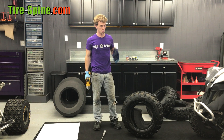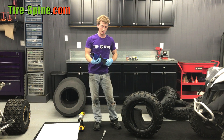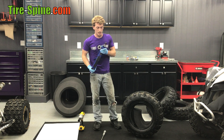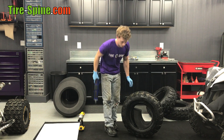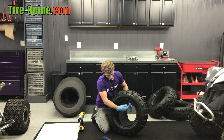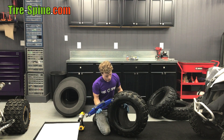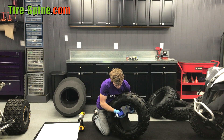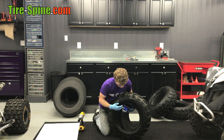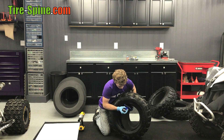Unlike the Sport ATV, you will need a couple other tools. These are all tools you can pick up at any little hardware store — most people have a drill, you can use a half-inch impact, three-eighths air, or electric. The next thing you need is a scissor jack, available at most local automotive places — O'Reilly's, AutoZone, whatever works for you. You've got the insert sticking up where the wheel will go. Take the jack — works best if you turn it upside down, opposite to how you'd use it for a vehicle — and put it on top of the insert, angling it more towards the insert itself rather than towards the wheel opening, then push it back in.